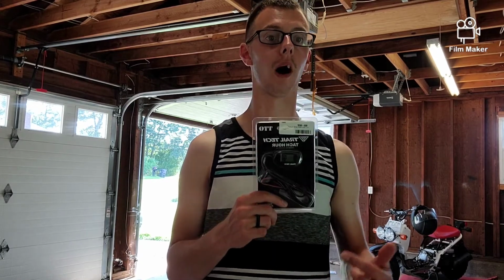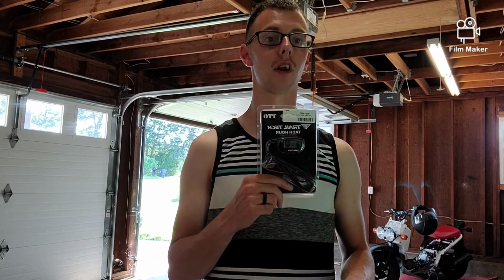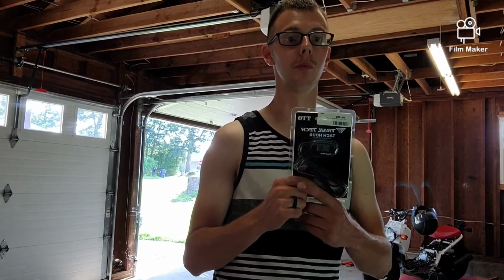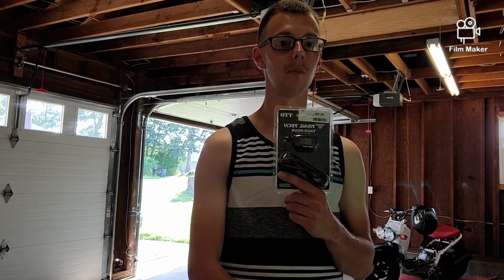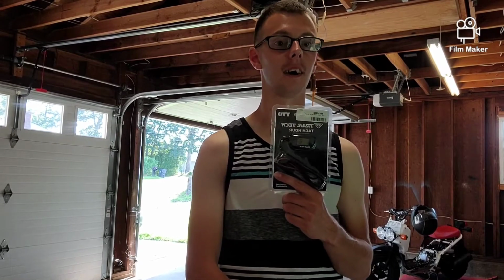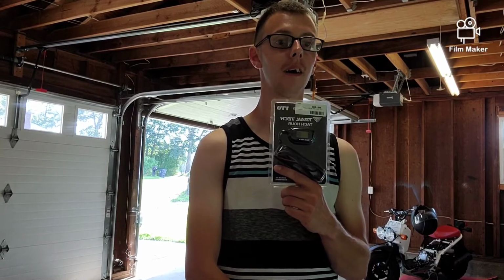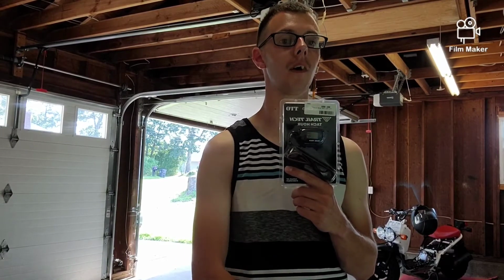One last thing, why you should get a tach or RPM gauge, and then we'll jump into the install. You should get one of these even if you're not planning on doing any tuning. If you are going to keep your bike bone stock and just commute to and from work, school, or the grocery store, in my opinion you should get one of these. It's always a good idea to know what your engine's doing. Is it surging? Is it hunting? Surging is going up in RPM, hunting is going down and dropping in RPM and then coming back up. Is it running smooth? Trust me, you want to know.